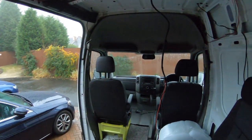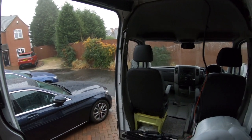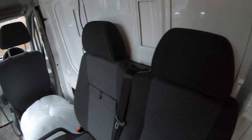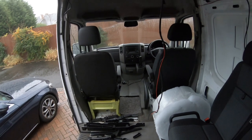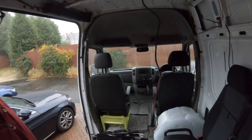So we've converted it from the double seat to the single seat in the front. But what that means is that now the seatbelt on the double seat isn't connected to the system, there's a sensor warning coming up on the dashboard that says the SRS — or the supplementary restraint system — has got a fault, and that's because the seatbelt auto-tensioner device isn't connected anymore.